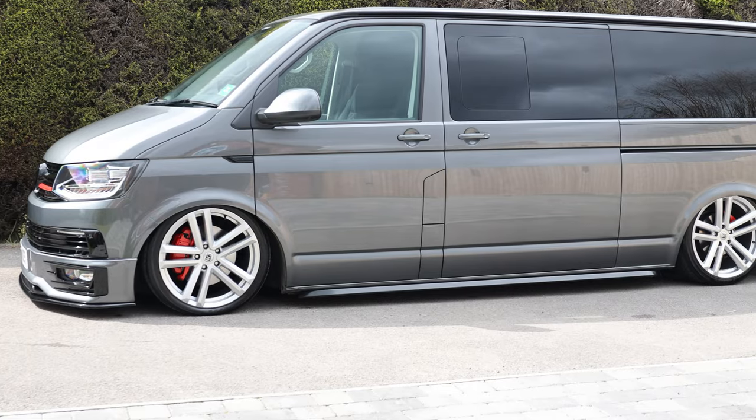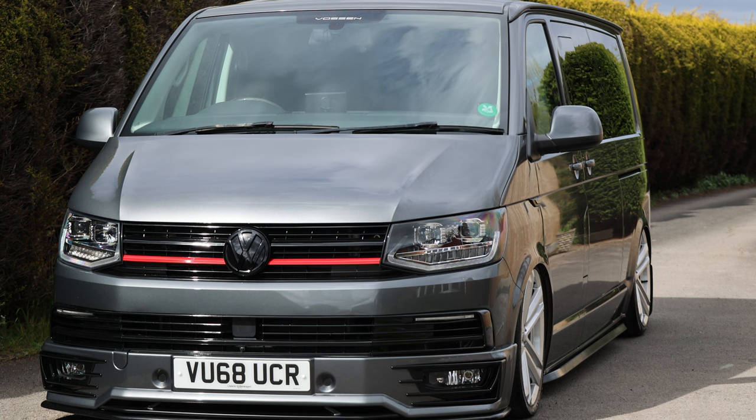The other wheels I run are the silver Navis wheels — Navis Twin Fives. These are also 20 by 9 and I'm running a 255/35/20 tyre on them. The offset of these wheels is ET42, so they actually sit slightly further into the arch than my black wheels do. The Navis wheels have been specifically designed for this purpose — they came from Transporter HQ, and the wheel has been designed from the ground up for the VW Transporter to meet load ratings and offset requirements.